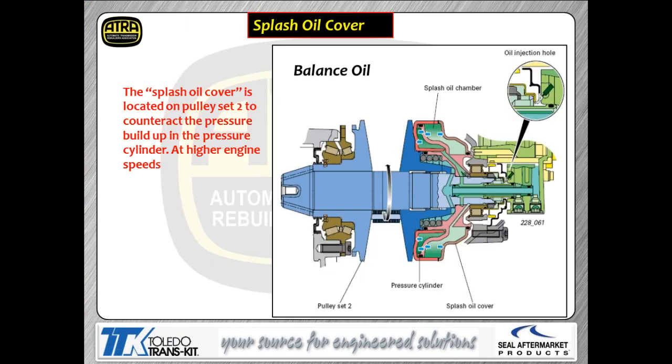Now, there will also be some balance oil in here. The balance oil is just like a compensator circuit oil that you have in a lot of the six-speed transmissions. It's used to basically push the piston back, give you some resistance to movement of the piston itself, and to make sure the piston returns when we get rid of the oil pressure behind it.